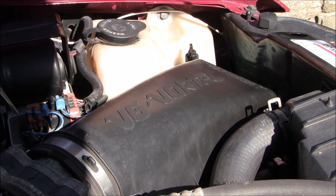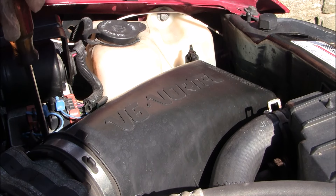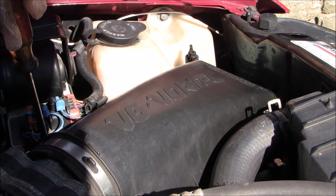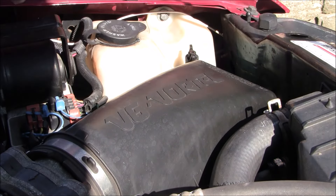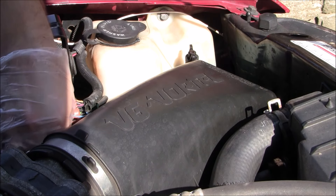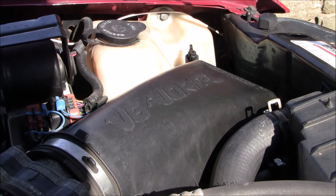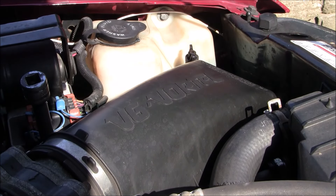Mine is the incorrect size because I lost the nut, but if you look straight down here right where my screwdriver is, there's a nut — I believe mine is going to be an 11 millimeter; I think the factory was 13 or 10, but it's been so long I can't remember because I had to replace it with an extra one I had laying around. Mine is an 11 but I have no idea what yours will be. I'm going to try to take that off with the air ratchet.